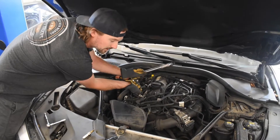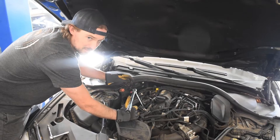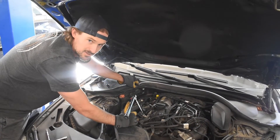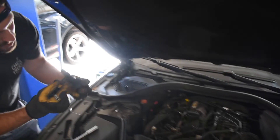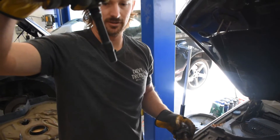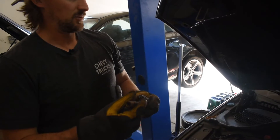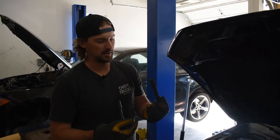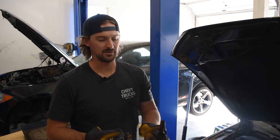I'm going to remove the fourth one as well and just make sure I can access the fourth spark plug. I think I can because I've got some long enough wrench extenders, but there are a lot of people I've seen online go through the whole process of removing the cowl, which I'm going to try to avoid if I don't have to. You can also tell if an ignition coil is starting to go bad. The first one looks pretty good, but the second one — you can see we're starting to get a little bit of browning on the tip. That usually happens when you have a little bit of oil or fuel getting into the ignition coil, which can cause them to go bad more quickly.